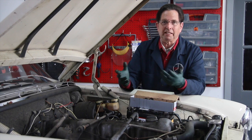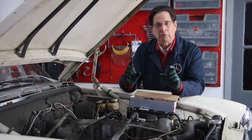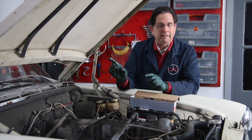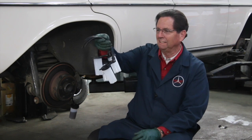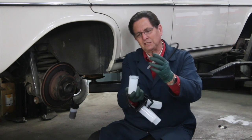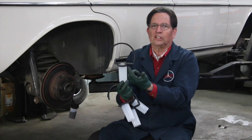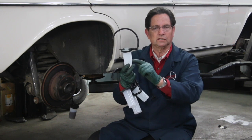You can go out and find your own tanks and make them if you want to, but we have four standoff tanks, proper tanks, and we have the correct hose which will fit right on those brake bleeder nipples that are typical of a lot of these older Mercedes. This is what the kit looks like. Each tank has a standpipe in it where the fluid comes down into the bottom of the bottle. And once you get up to about an inch, no longer can you get air sucking back into the hose. You want about an inch of fluid in there to make this work right.